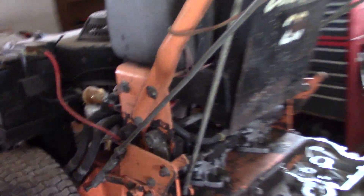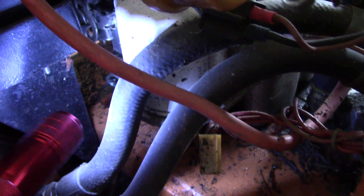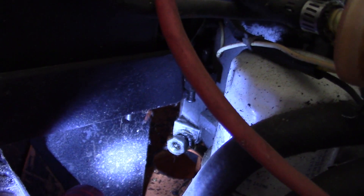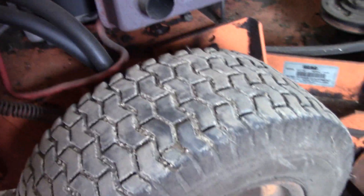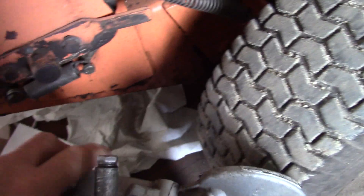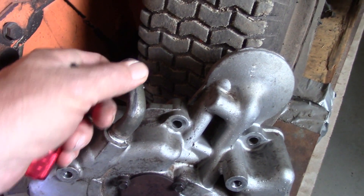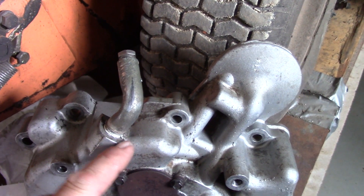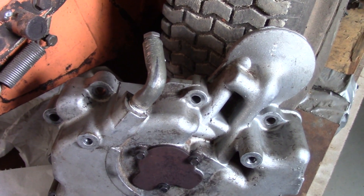This other mower has a bad oil drain plug. I'm shining a light in here - there's a steel pipe plug going into a cast aluminum pan. That's what happened: the pipe thread gets turned in too tight and puts a hairline crack right there, so it's drip, drip, drip, drip.